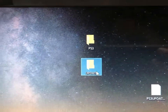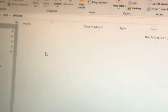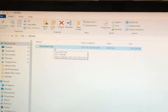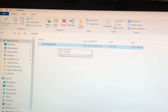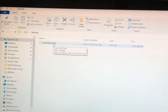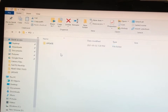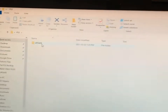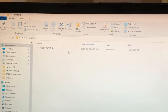Once the download is complete it will look like a file called PS3UPDAT.PUP. First you create a folder and call it PS3 — all capitals. Inside that folder put another folder called UPDATE. Then take the software file and put it inside that UPDATE folder. One thing you have to make sure: do not change anything — not the spelling, not even a dot. These are all code and even a dot will make a big difference. Keep all folder names in all capitals.